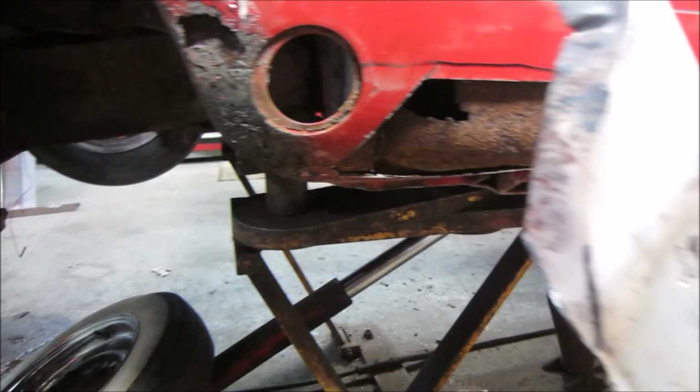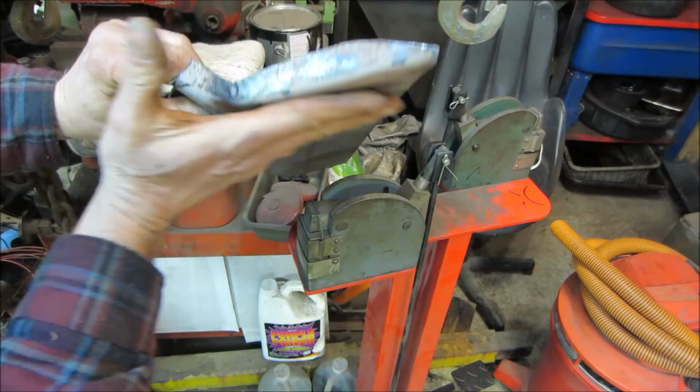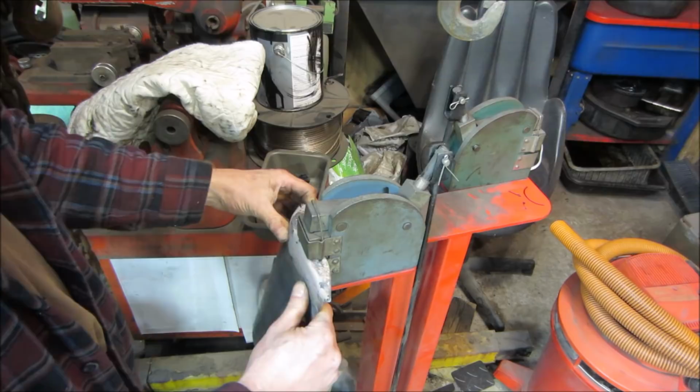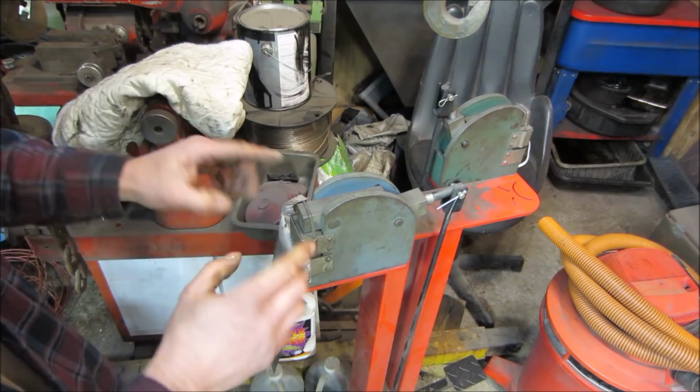The beatings begin. So one problem the panel has: when I folded this over, it made this edge completely flat instead of having a little bit of a curve to it. So we're going to go up to the shrinker stretcher and see if we can help that out some. What this does inside here is two jaws going down and pushing together, pulling down, pushing together, curving it this way. The one on the other side does the opposite.